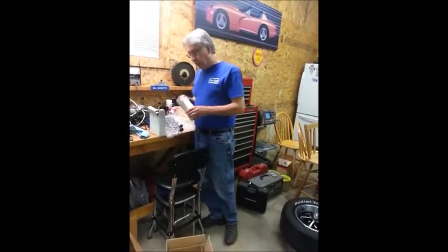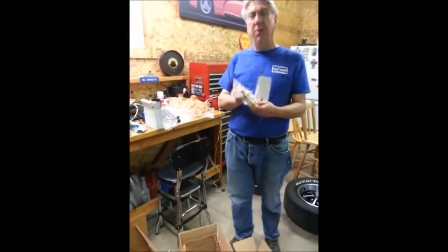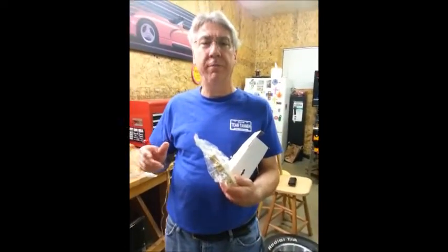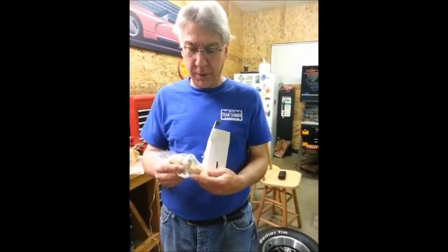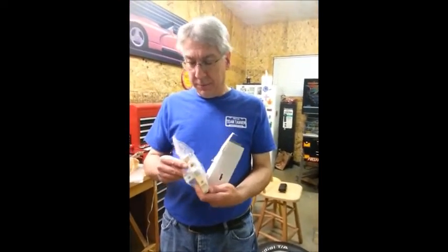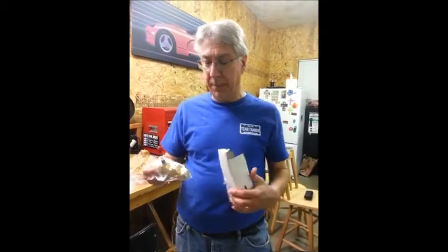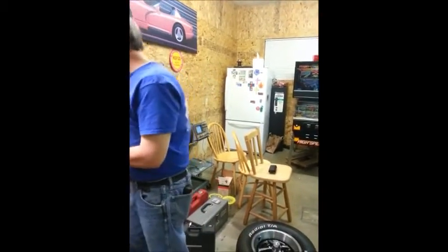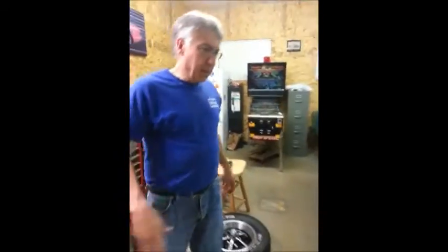The proportioning block is a custom block, so you know, on a lot of disc brake conversions you'll have a variable proportioning valve that you just put in series with the line going to the rear brakes. Supposedly this needs no adjustment. This kind of mimics the Mopar A-body, E-body disc brake proportioning valve. Hopefully that'll be plug and play.